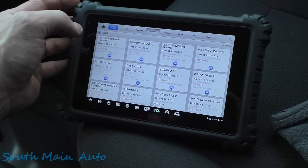All right, that's it, folks. Show's over. So let that be a lesson to you. Like I say, with these older Chryslers, I was pretty sure when you shut that key off, that's when it ran just the O2 or the O2 heater, but evidently both. It satisfied both of them. Key off. We had four not set. No, EVAP was set, so we had catalyst not set, O2, O2 heater. I don't know what the other one was. Don't know, don't care, because we don't have any codes, and this guy should be happy.